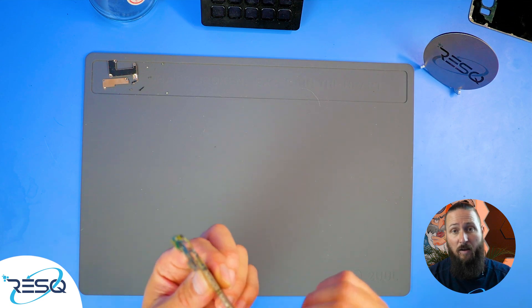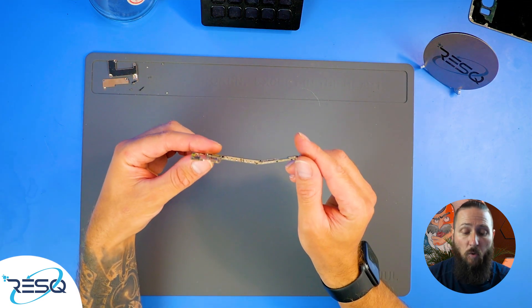The Galaxy S6 is one of the last Samsung Android smartphones on which we can perform data recovery by chip-off. It has a BGA 95 chip that we can desolder and read using the Easy JTAG box, giving us a complete dump of data located on the UFS chip. In this case, we have a cracked board, so we have two options.